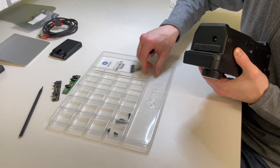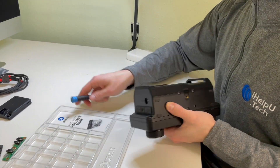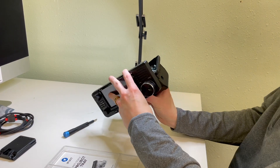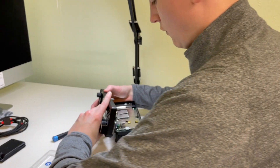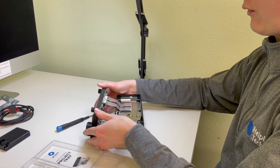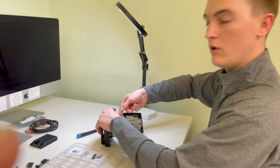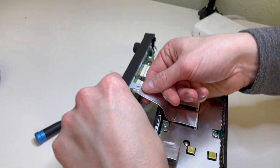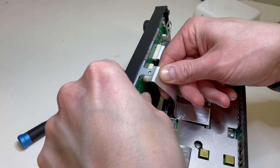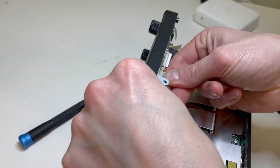Now with those four screws off, the ones on the top are different from the ones on the bottom, which is obvious due to the length difference. We're going to take the radio and pull it apart, setting the housing battery-side down and the face of the radio facing ground. The two ribbon cables can just slide to the side. You can disconnect them if you want — just pull them straight out — but there's not really a need to since they're a little bit fragile. If you feel comfortable leaving them in, just leave them.